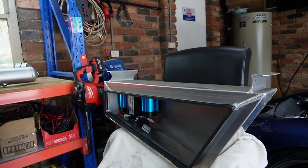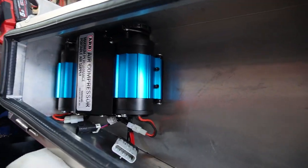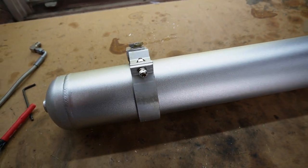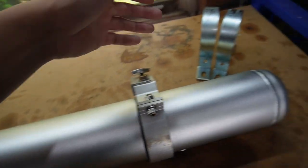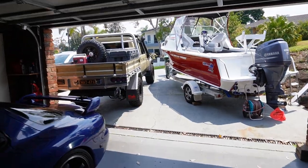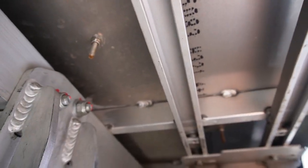Last night we mock-fitted the compressor inside the toolbox — it's just held in there by a couple of bolts. We need to work out where to put the air fittings, the bulkhead, and the wiring loom. But before that we need to sort out how to fit the air tank behind the toolbox. The Boss Suspension 6-liter tank comes with brackets, but there simply isn't enough room behind there. I've decided to mount it straight to the tray — there's a unistrut channel running down the length of the tray, the same channel the toolbox mounts to, and we're going to use a couple of channel nuts to mount the tank there.